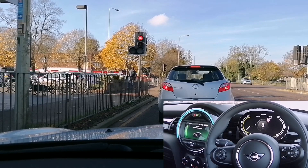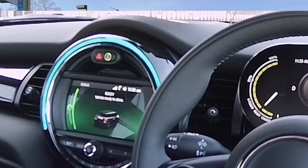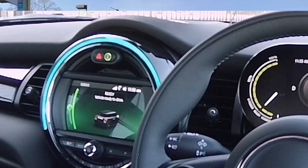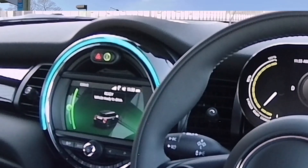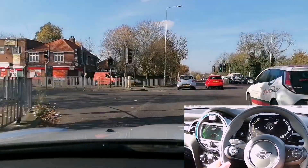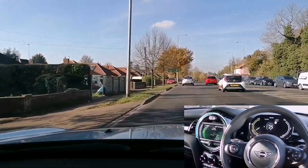You've also got the Mini E-Drive image on the media screen. As you accelerate, the front wheels turn yellow with a forward arrow indicating power use. In regen mode the wheels stay yellow but the arrow shows energy being recuperated back into the battery. In coasting mode there's no yellow on the wheels at all. That's a really good gauge because it updates instantly with your throttle input, so you can use it to monitor whether you're driving efficiently and balance the throttle into regen or coasting mode.